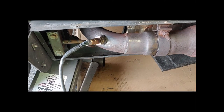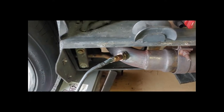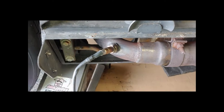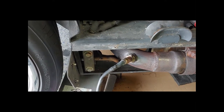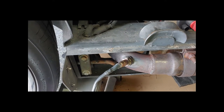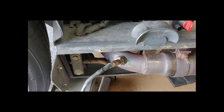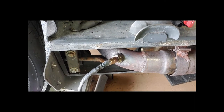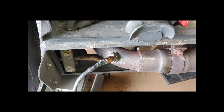There's the sensor installed. We'll have to figure out how we're going to route the wiring, but I've got plenty of room to clear the sill, so we're good there - that's a perfect spot for it. The manufacturer says to keep 18 inches down from the collector pipe or exhaust exit. If you're running high-powered turbo applications, they say 36 inches - probably because there were a lot of problems with the Bosch sensors and the heat was basically destroying them. But from what I hear, this is a pretty good spot.